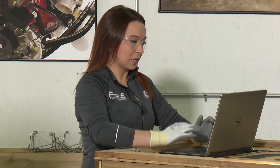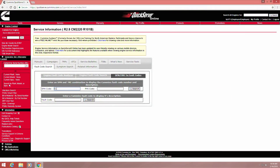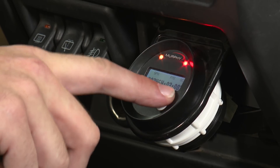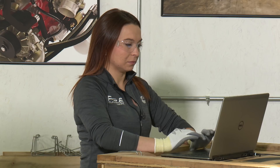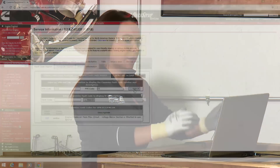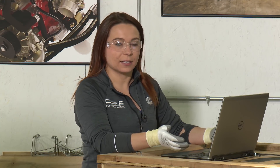All right Steve, what's that first SPN code? The first one that popped up was SPN 000132 and FMI 04. That third bank of numbers — 003 — is just how many times that fault has occurred. This SPN and FMI combination correlates to fault code 357, which is an amber fault as shown on the Murphy gauge. That's for the engine intake air mass flow circuit voltage below normal or shorted to low, which makes sense because I unplugged the mass airflow sensor.